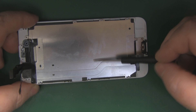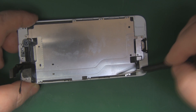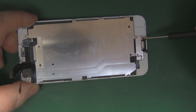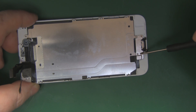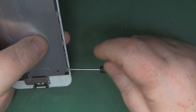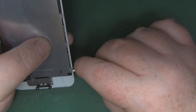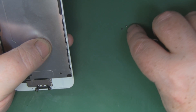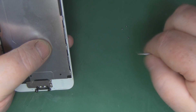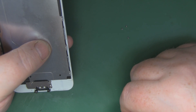Next, remove the backing shield — there are three screws down each side and screws at the bottom — and remove the home button shield at the same time. Make sure you place all screws on your drawing in the exact position you removed them from, because a lot of these screws are different sizes and mixing them up will cause real problems when putting it back together.